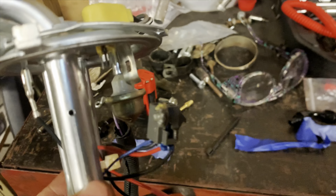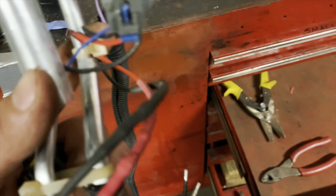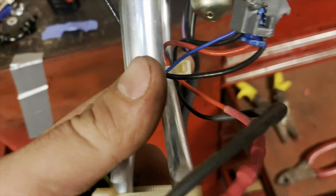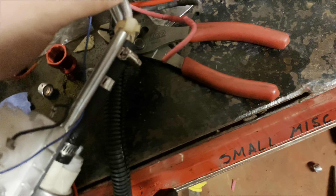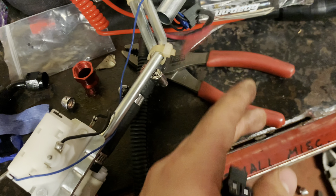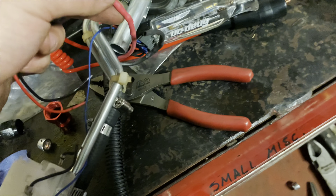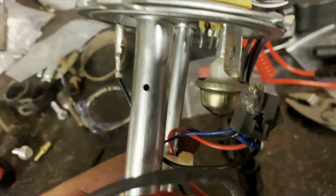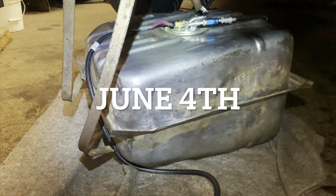So I'm taking apart the fuel pump, and I look at it — I used my little 9-volt setup with masking tape to check if the pump still works, and I still heard the pump move. I look at this harness and it's melted — but that's a ground. I'm like, why is the ground melted? I tug a little bit on it and it just slid right out. That could have been a giant fire and lit this thing up. Luckily, it didn't. I'm probably just gonna have to buy a whole new hanger. That could have been bad. I'll probably show in the video what happened to the old wiring — I probably should have done this from the start.